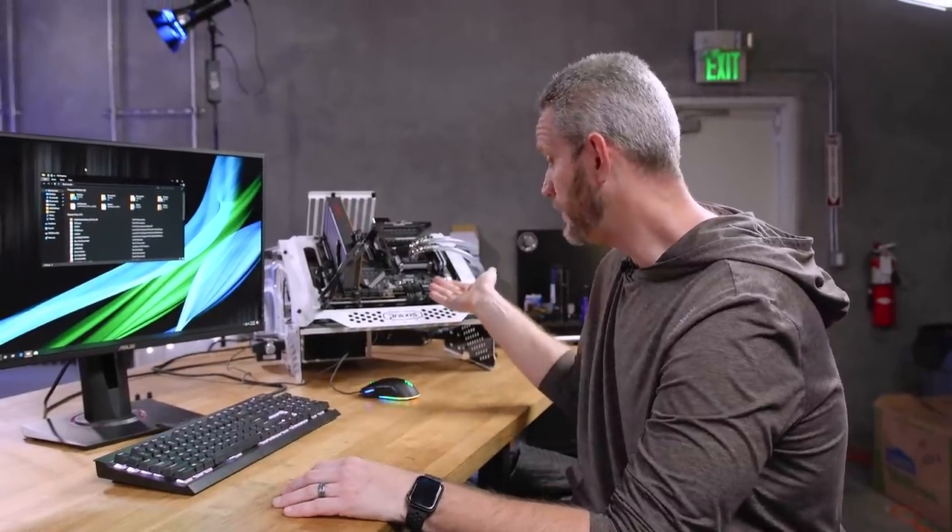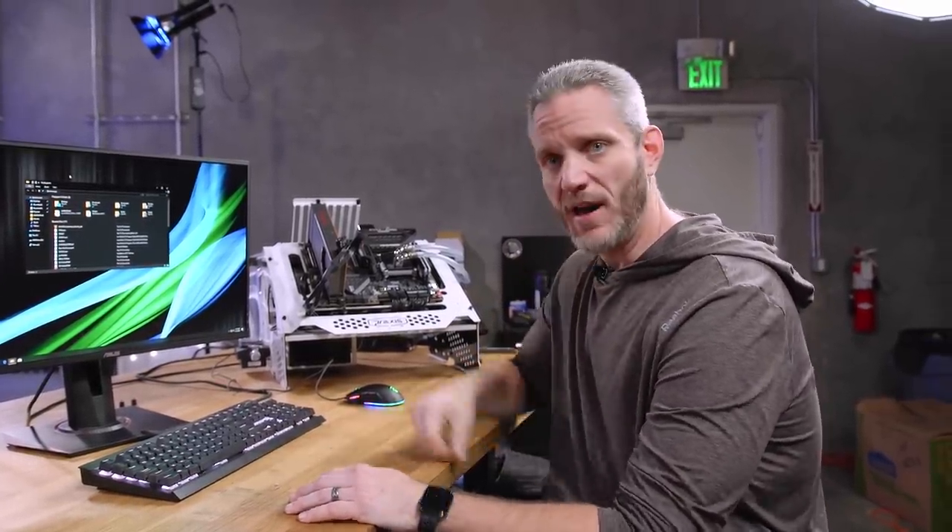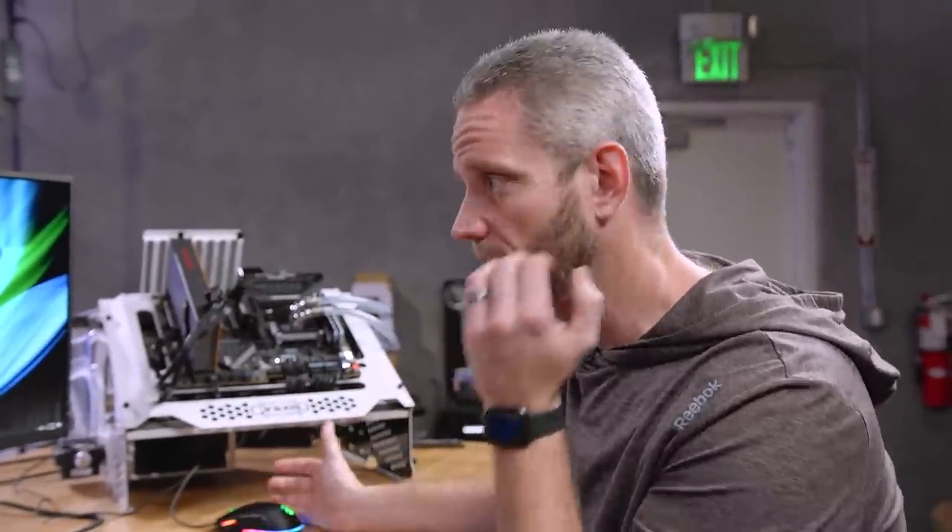So what it needed was the overclock to boot. Does that mean that if somebody built this system right now they would think they had bad hardware because it never would have booted from the beginning? But I never updated the BIOS on this motherboard, and I'm also the kind of guy who goes right into the BIOS on first boot and immediately pushes the overclocks — so I don't think I've ever run this thing stock.